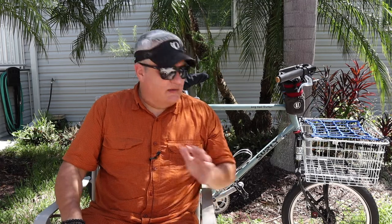The Clydesdale fork was designed so that you could take an old 26-inch wheel mountain bike and turn it into a cycle truck, a cargo bike, or even a touring bike. And to that end, it works very, very well. Even though it was designed for bikes with 26-inch wheels, Matt's got some measurements on there so you can figure out whether it's going to work with your bike or not. I've seen it built up with different size wheels — 700C and 650B. At the end of the day, as long as this platform here is level with the ground, you're likely going to have a good result.